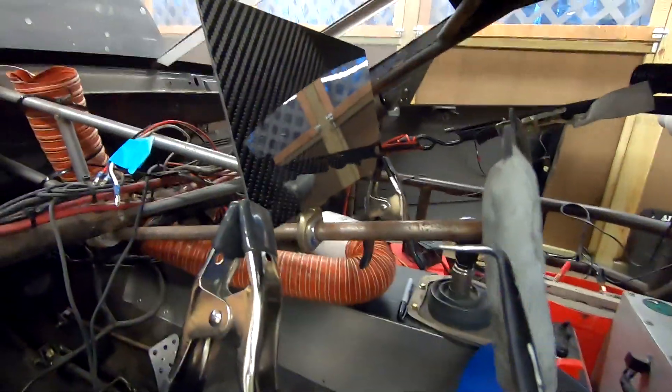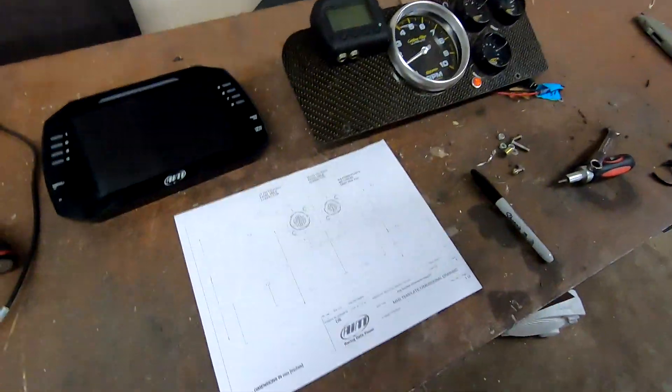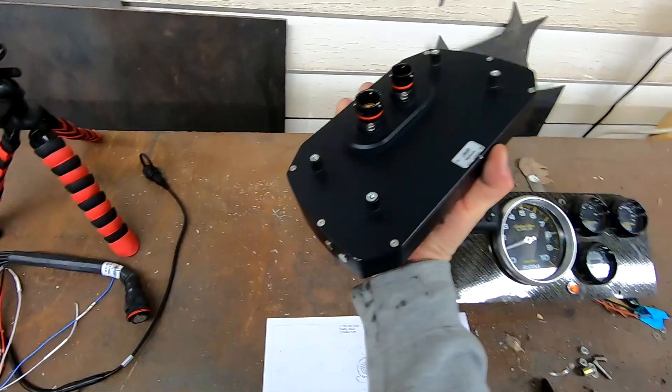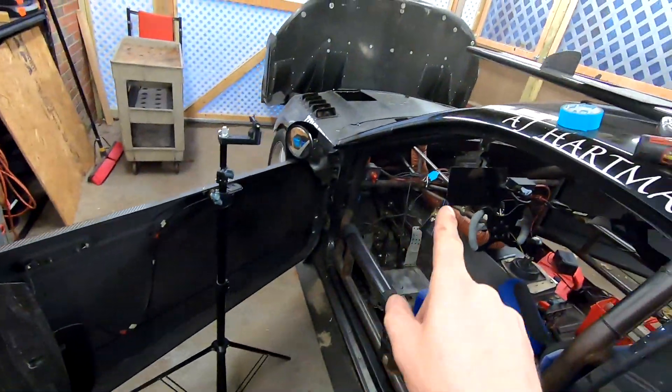A quick little tip: if you have to hold something in position, these little spring clamps are always handy to have around. And then to mark the holes behind it, just a pick tool — you can get in there and scribe the mark that you need. It's a quick, easy way to hold something where it needs to be so you're not holding it with one hand and trying to mark the hole and risk it moving. Now that that's marked, the other thing we have is this one-to-one template of where I need to drill the holes that go to the mounts on the back of this, then cut it out so everything passes through our carbon panel.